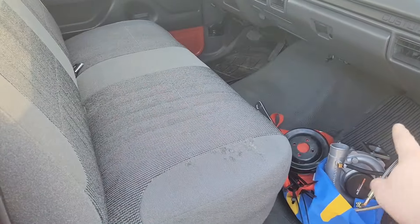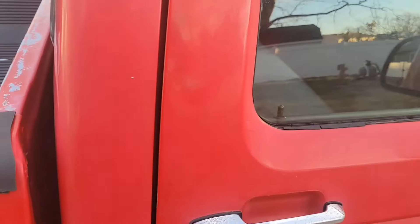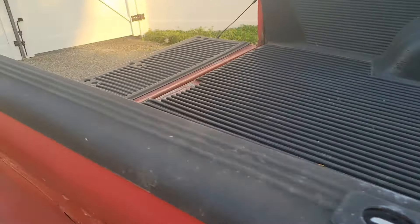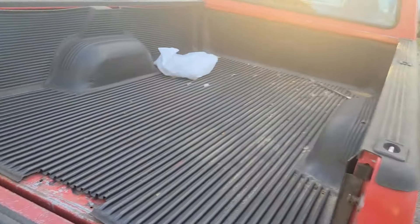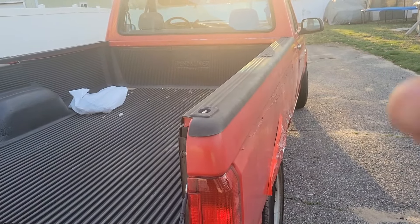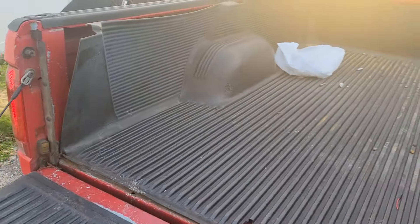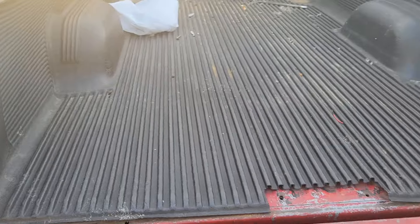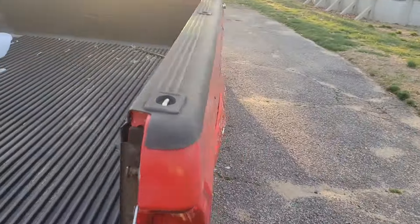I have the oil lines for the turbo and a new water pump pulley because the one I have right now is too small. I think my belt, every time I change to a different size belt, it's just spinning on the water pump. I'm going to try a little bit bigger water pump pulley so on startup I don't hear that screeching from the belt.